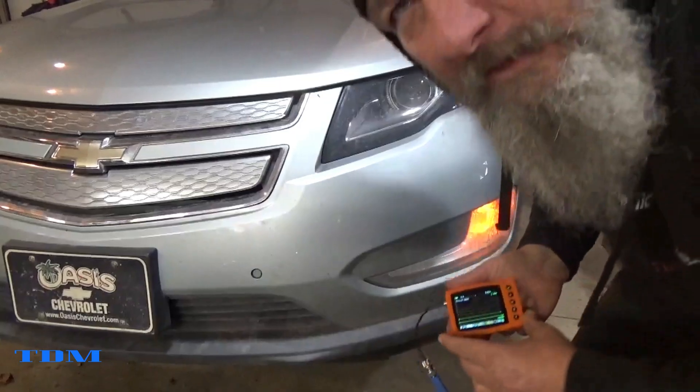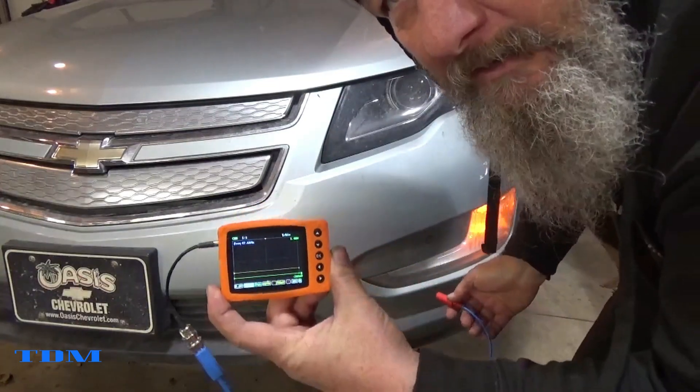What we're going to do is put the car into service mode. With it in service mode I can safely put it in gear, but I still took all precautions — I have the parking brake on, and for another project I already have it up on jack stands and blocked so the car won't move when we put it into gear. We have to put it into gear to check the park assist sensors.